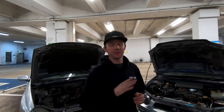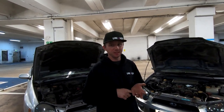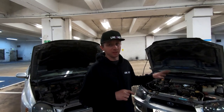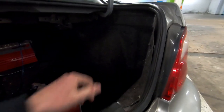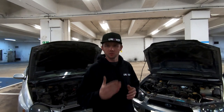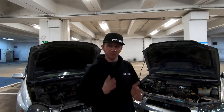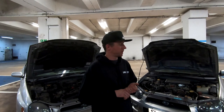It was a matter of trying to Frankenstein it, and what I recommend doing — and what I'll do next time — is use everything from the right car to the right year. I did originally try to use the Forester wiring loom and that had so many differences it was unreal. While we're on the subject of wiring: the one thing these new age cars have that the classics don't is what's called the fuel pump control module. That's hidden away in the boot, and unless you know about it, it's going to cause you issues with the fuel pump. It essentially runs the fuel pump at two different speeds, and once the module is talking to the ECU it will run it at two different levels depending on whether you're on power or not.